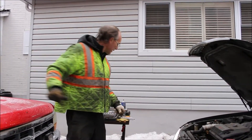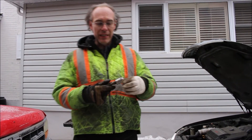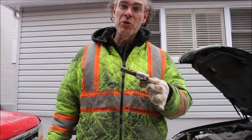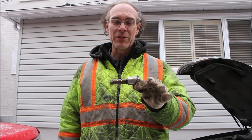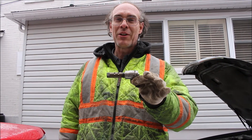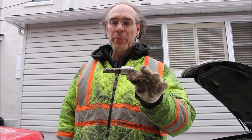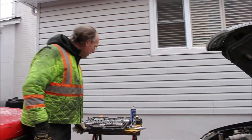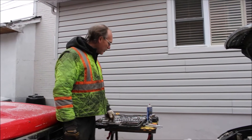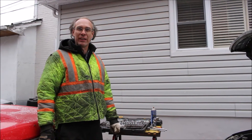So we're going to change the oil control valve. This is what an oil control valve looks like — this is a used one I picked up at the wreckers. I actually picked up a couple of them. Because this happened on a day I can't readily get a new one, I'm going to put the used one in. I'm pretty confident it works properly — we'll find out soon enough. We need a few tools; just a simple ratchet set and an Allen key set is really all you need.